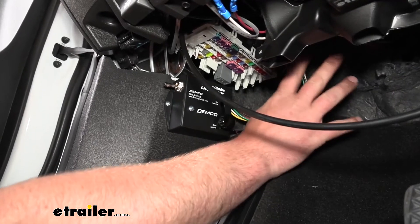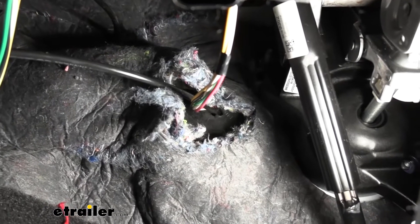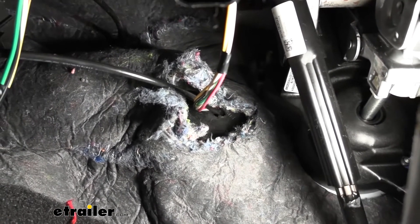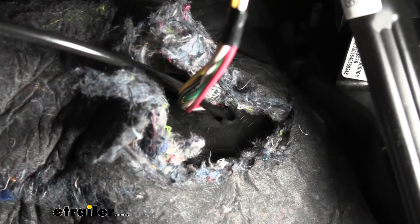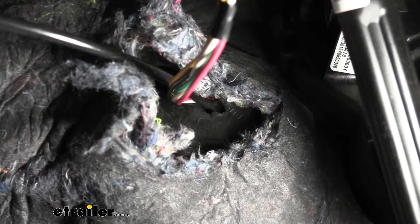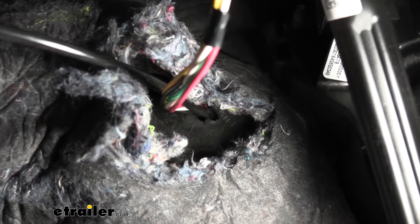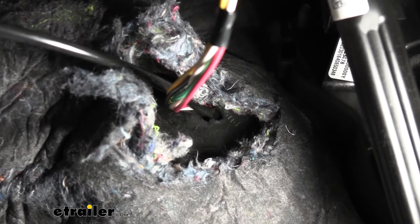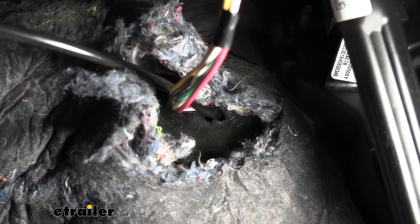To get our wires through to the engine compartment, cut the carpet a little behind the firewall area and you'll find a factory grommet. We punched a hole through that grommet just big enough to get our wires and nylon air tubing through. Be really careful when you do this — you don't want to damage any of the factory wires that run through there. Stay off to the side and take your time. Once you have that opening created, push your wiring and air tube through into the engine compartment.